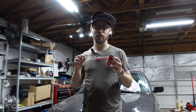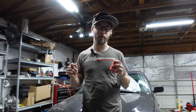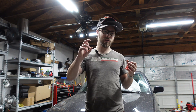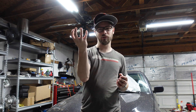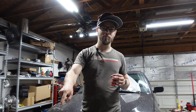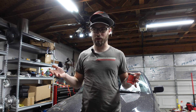BMW rather liked this second approach because they basically have a built-in catch can, but it doesn't require emptying. Crankcase gases from the valve cover come in and go into this little plastic cylinder, swirl around, and collect at the bottom. But instead of just staying there, they get drained down into the oil dipstick tube right back into the oil sump, so it kind of recycles the oil that way.